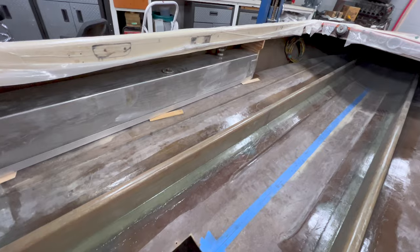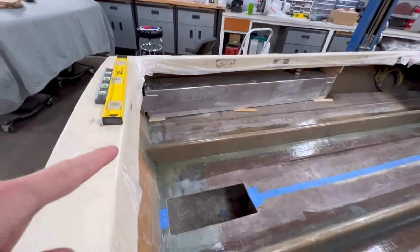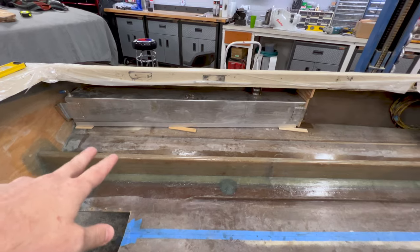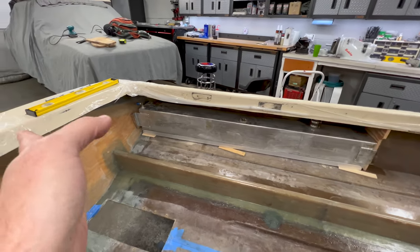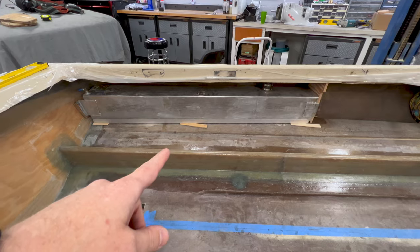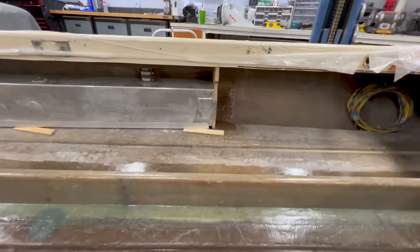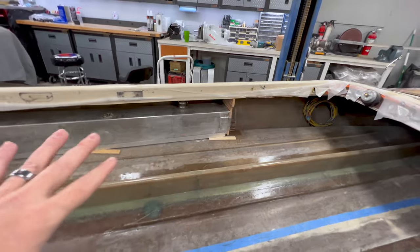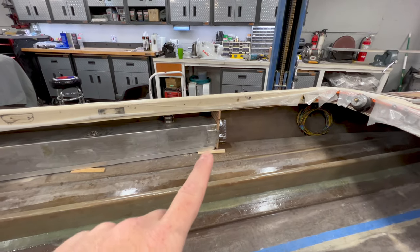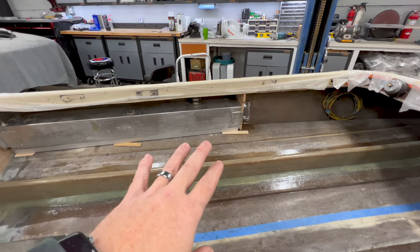On this tank, I already got the angle cut and mocked up with the corners rounded. The aluminum angle is sitting flush on the outside of the hull, with wood shims holding it 90 degrees to the fuel tank — if I laid it flat on the floor, the angle would be leaning inward and not perpendicular. I've already prepped behind the bulkheads and laid a layer of vinyl ester resin back there, so the next step is to get these bulkheads tabbed in.